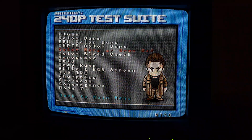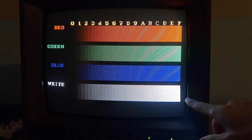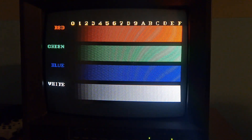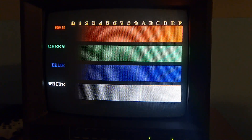And of course the misconvergence that you usually get at least in one corner, especially if you own a Sony. In terms of color bars, this has a very neutral color — no red push, nothing like that, so we're not dealing with anything too crazy on the NTSC side. Super good white, super good dim. Overall, a very neutral color, especially transitioning from dark to light. I really like that about this set — super nice and super accurate in terms of its color.